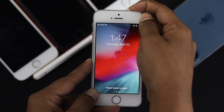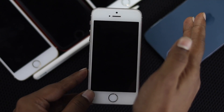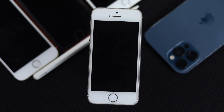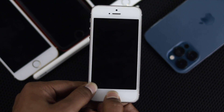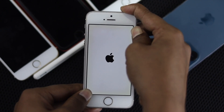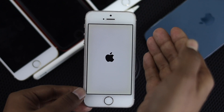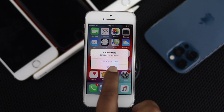If that doesn't help, don't worry. Go ahead and press your power button to power it off. Wait around 5 to 10 seconds, then press the home button a few times — say 5 to 10 times. Afterward, go ahead and press your power button to turn it back on. Once the Apple logo comes up, wait for your iPhone to turn on and check whether the home button is working.